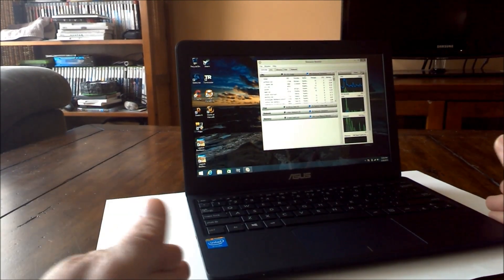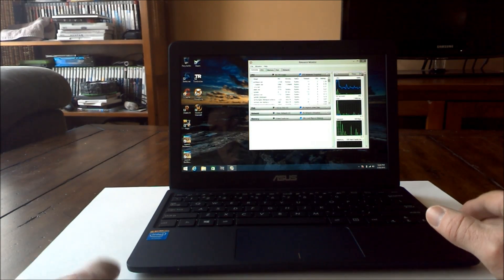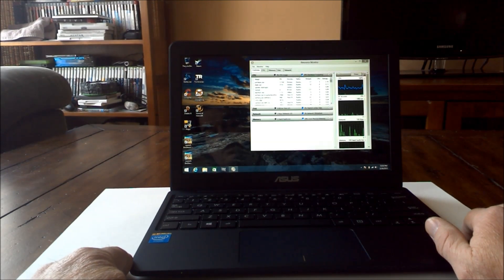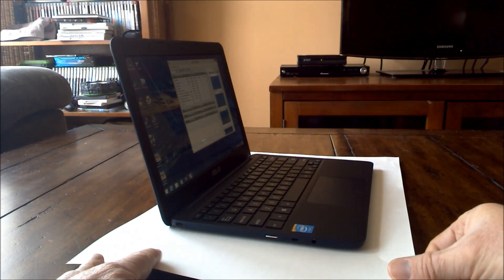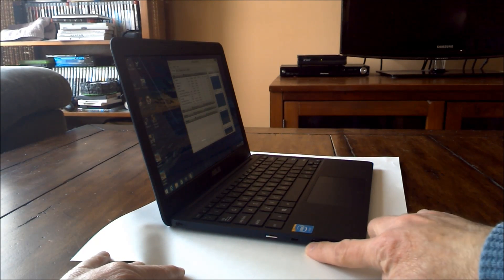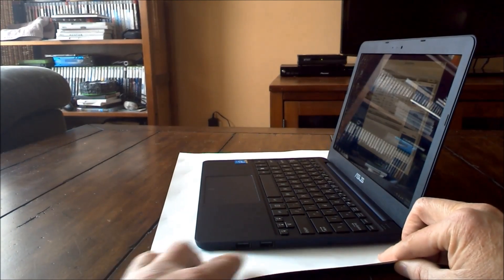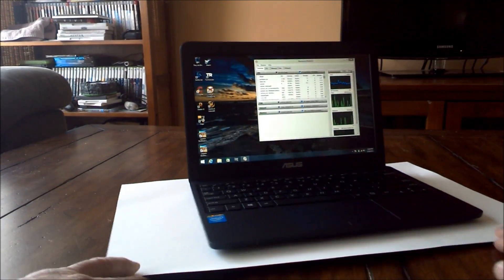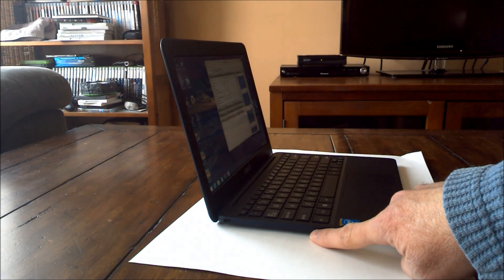The case is nice and feels great. The screen is 11.6 inches — it's bright, responsive, and very crisp. It does have viewing angles that wash out, as it's an LCD screen, but viewed head-on it's quite nice. Being critical: it really should have a full-size HDMI port rather than this micro HDMI port, especially considering it has two full-size USB 2.0 ports on the side. I really don't know why they went with micro HDMI.